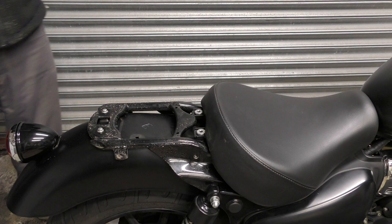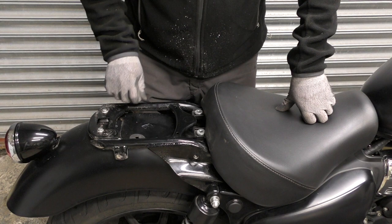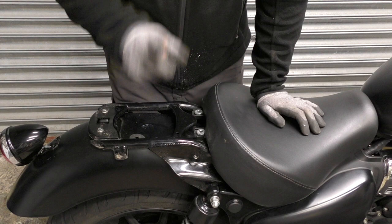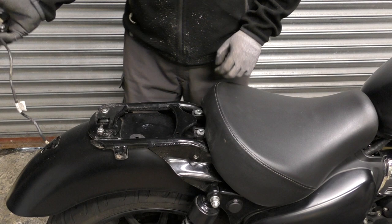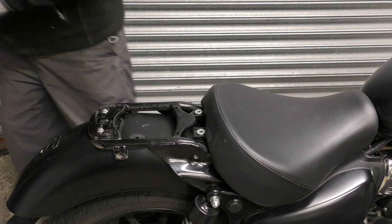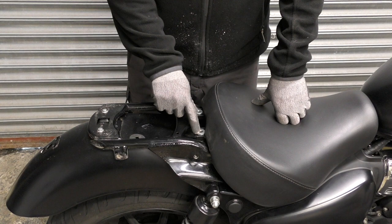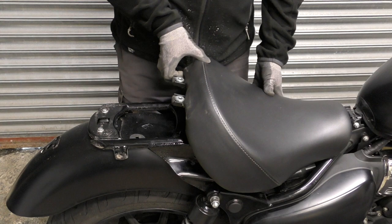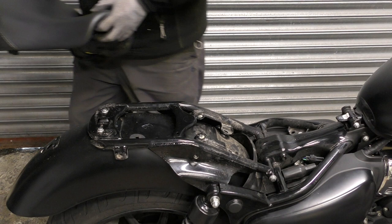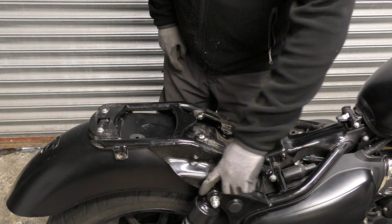That's quite a significant piece of metal really. The mud guard bolts up into this — this will come off but there's a bit of complication to that, which we'll come to. The rear light — I've done that again — that's quite nice, I might like to reuse that. Nice quality stuff. Now once you've got the pillion pad off you've got two bolts at the rear. Once they're out, there's a tongue at the front — this will come out, all very straightforward. And there's that subframe — this is the original frame of the bike, the shock mounts.